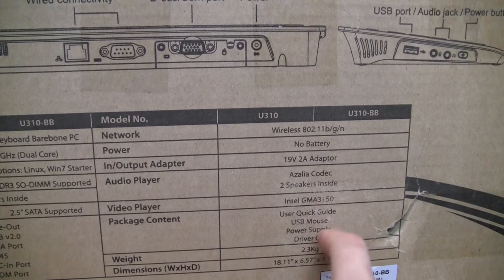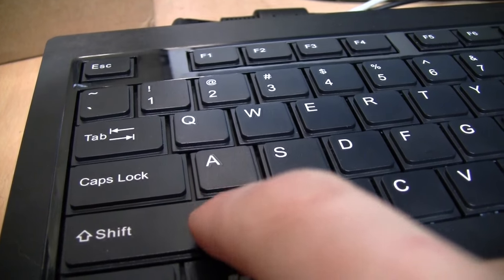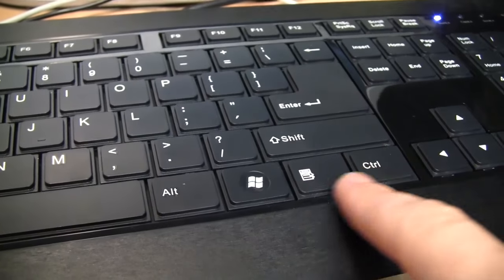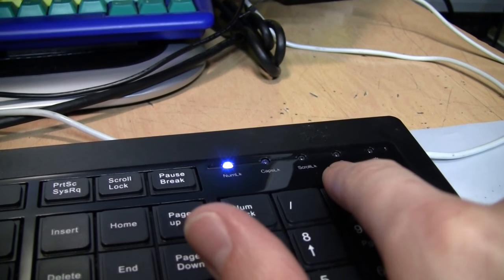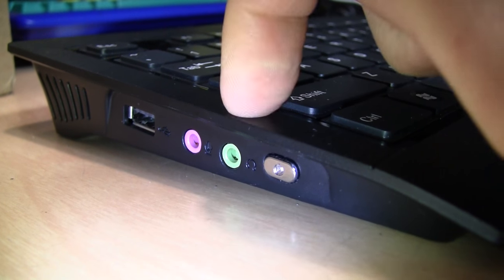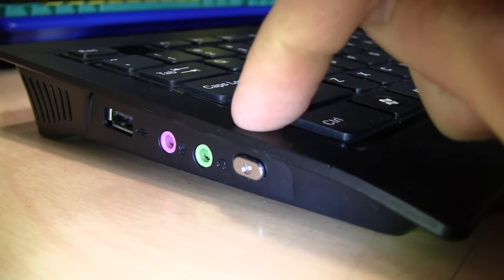The keys don't have any frame around them, so it's actually a pretty nice full-sized keyboard with all the normal keys in the normal layout you'd expect. There are indicators for num lock, scroll lock, and caps lock. On the left side there are one or two built-in speakers, another USB port, and microphone and headphone jacks — though these are software-definable. When you plug anything in, it asks if you want to use it as line in, line out, microphone, or headphones, so you can plug headphones into the mic jack if you choose.